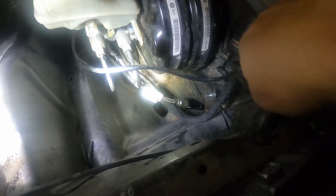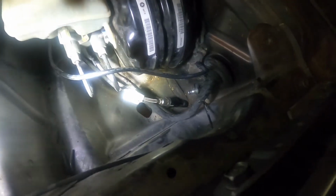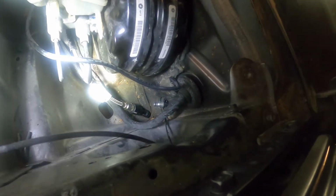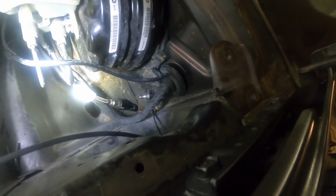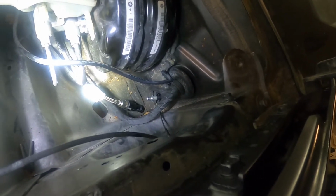And then up here where this grommet is, where the reservoir line needs to come through to make it to this nipple on the brake booster. So the Challengers run this hood prop wire and the master cylinder reservoir line in the same grommet. The Chargers run one of the wiring harnesses through that grommet hole that we need. So I think we're going to make some modifications to that grommet, run that clutch line through there, and tag it right into the brake master cylinder, which they share a reservoir. We're just going to have to cut that little end off the master cylinder there.